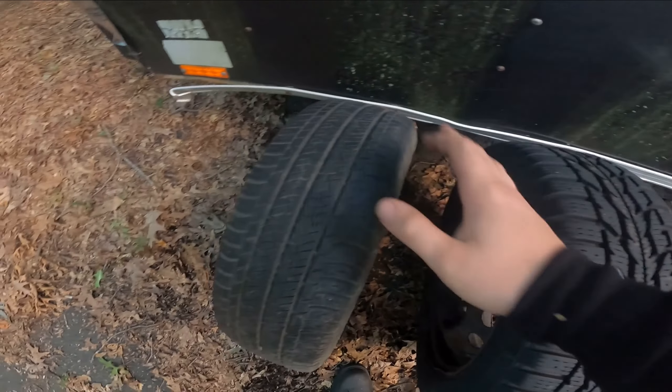Another marking on the side of the tire that some people might not know is up here — it's a little hard to see — where it says tread wear 360. What the tread wear on a tire means is: the higher that number, the longer the tire will last. A tire with a tread wear of 400 will last half the time of a tire with a tread wear of 800. Usually the lower that number, the softer the tire is. This is an all-season, so it's got a number of 360. Comparing that to my racing slick right here — this has a tread wear of 100, so these tires will last a very short amount of time on public roads. That's tread wear.